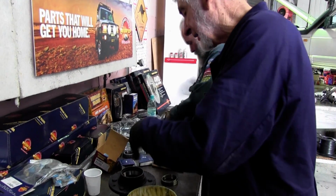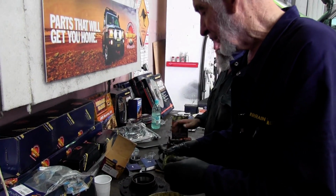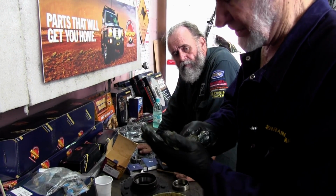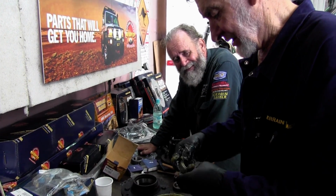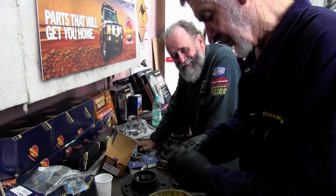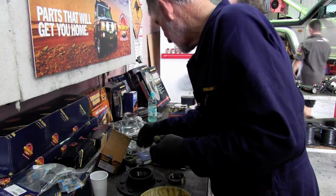I don't put a lot of grease in the hub. I just have it sort of level, so mechanically it doesn't allow the grease to come out of here because there's other grease there. But I don't jam it full. But I actually grease it till it really comes right through there. Well, you want the grease on the bearings, not on the hub. Yeah, that's true. So it's come through there and it's quite heavy, it's quite tight to turn, and I can hear air coming out of it sometimes. So I really make sure those bearings are packed and we don't have any more trouble.